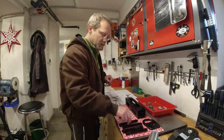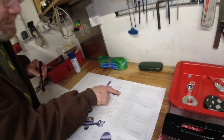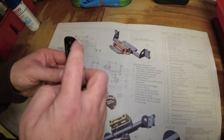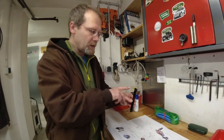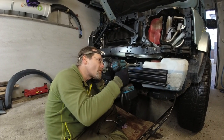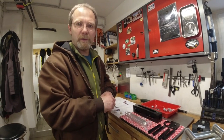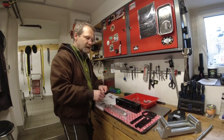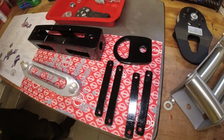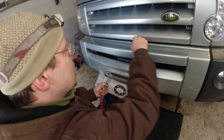Another annoying thing last time was getting nuts behind the bumper to get the bolts in. In this area I made straps with an M10 nut welded to them, so I can scoop them up in the back and have the nuts retained - it should be easy now to get bolts in and out without fumbling washers and nuts behind the bumper. We have four of these. These pieces are also in the free laser cut files. Thanks so much to those who donated money for the winch files - that was really kind of you.